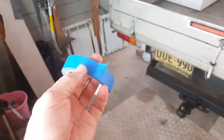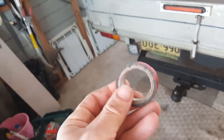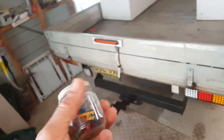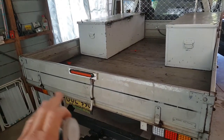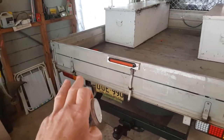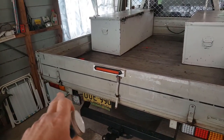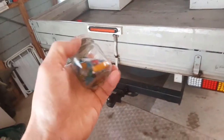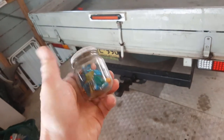When you do the mock-up for the wiring, to hold wires together that you've just twisted, use paper tape. If you use electrical tape it just falls off — the paper tape has more adhesion. You're going to need fuses. If you wire it up and come back to find it's all cross-wired — like the indicator lights on and the brake lights are flashing — you could blow fuses, so you'll need spares.